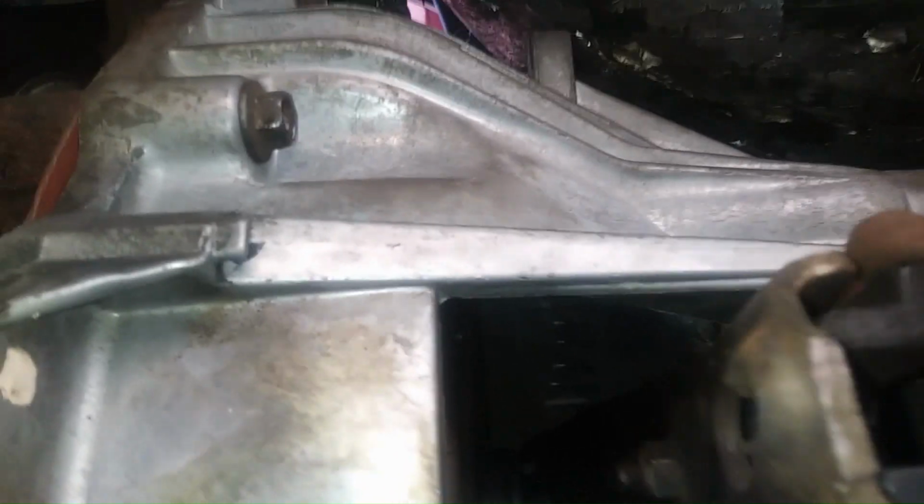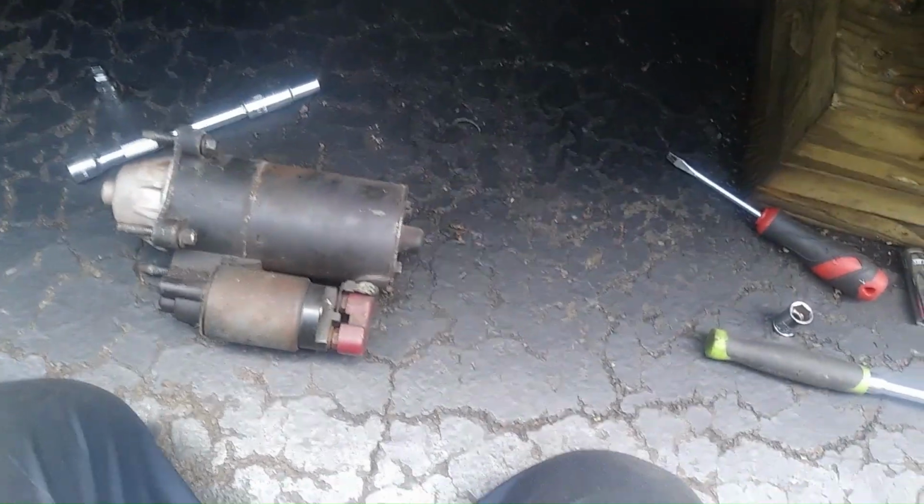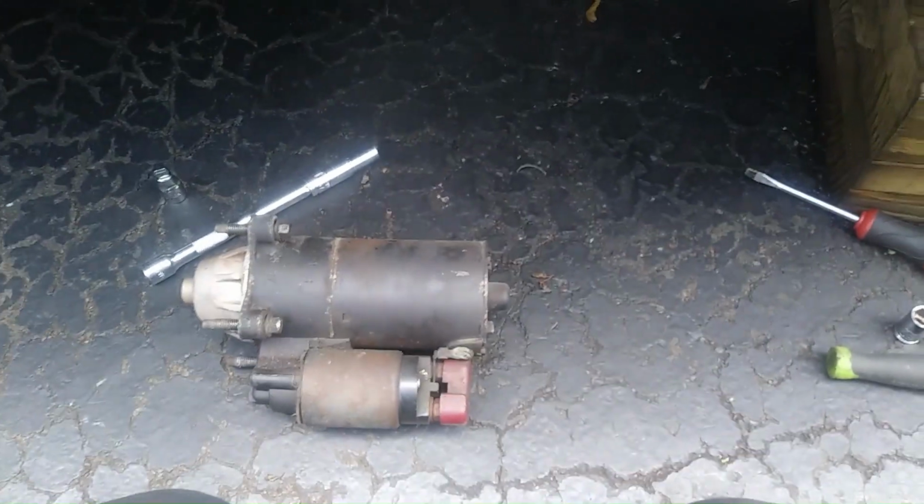So now we've got all the driver side ones in the bottom. I'm gonna shine a light in there. There's our pressure plate area, there's our clutch fork. You can see our throwout bearing sliding. So that should be good to go. All right, we've got the transmission all in. All seven bolts are tight. I also put the little dust cover on. I'll show you that in a minute.